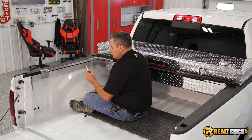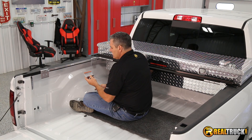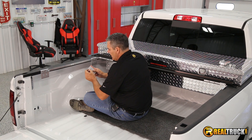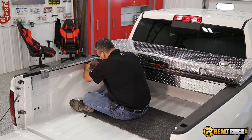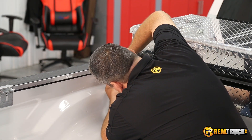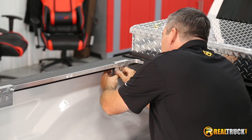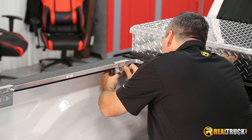We're ready to attach our clamps. We have our rear piece of our clamp — the part that has the orange neoprene strip on it. That part is going to go up under here against our truck bed to keep it from damaging the truck. The piece on the bottom is gonna fit into some notches on the bottom of this L-bracket hinge. We'll push it down just a little bit until it seats. Then we put our hex bolts in — make sure you put a washer on each bolt and attach them in.